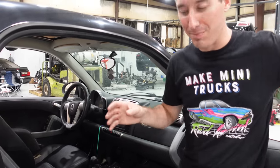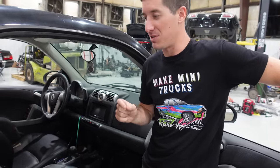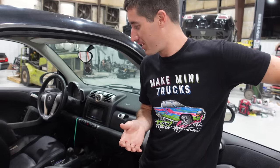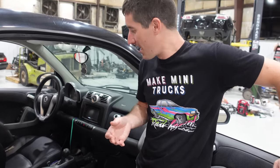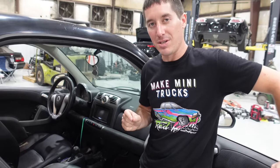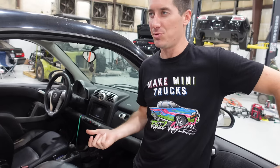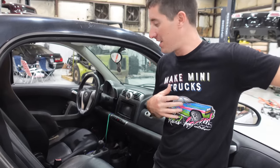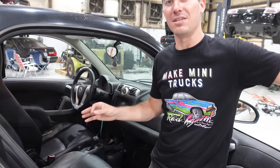That engine, going back to that, and this thing's super lightweight, 70 horsepower and 68 foot-pounds of torque, that's mated to a single clutch, which is really cool, like it's an Aventador, basically, or an old V10 M5, M6. It has a single clutch, the computer controls the clutch, and it's a 5-speed. The first generation Smarts were 6-speeds, and then they went to a 5-speed. It seems like a bad decision to me, but I guess they didn't want the computer to have to shift so much. So the computer is handling all of the clutch duties.